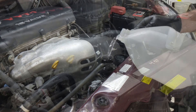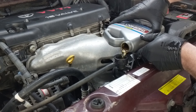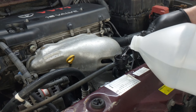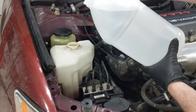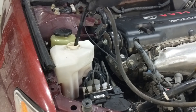I'm using hot water because it'll help it get up to operating temperature a little quicker when I run it later. Then I'm putting in a bottle of flush treatment and rust remover — this is kind of the scrub cycle. I top off the radiator with the treatment and water and fill up the overflow reservoir, and then I'm going to go drive it for three to four hours or 100 to 200 miles or so to give it a good scrub.